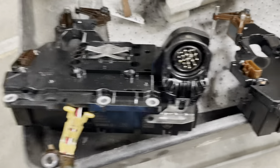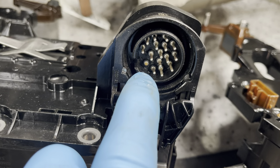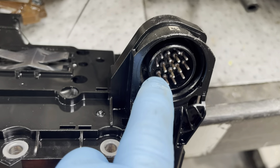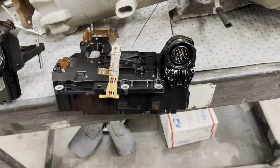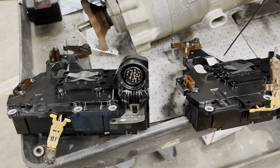Here's another one. This computer has a broken pin — actually, the pin is missing. As you can see right there, there's no pin. Look right here — ta-da, there's a pin. So you've got to examine your valve body computers when you get your transmissions. That one's not broken, so you've kind of got to go over things.